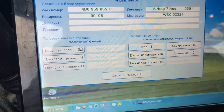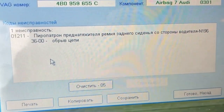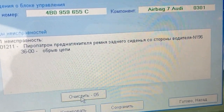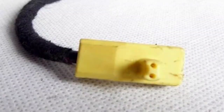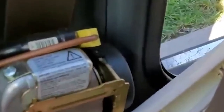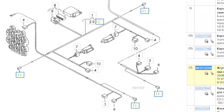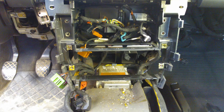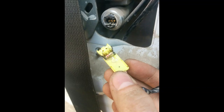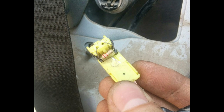When you connect a diagnostic scanner, you can see that the error is related to the driver's side rear seat belt pretensioner, fault code N196. After studying a little information on this issue, I came to the conclusion that in most cases it is the contact on the seat belt pretensioner connector. There should be no problem in the wiring itself, because from each pretensioner goes the wire without any connection directly to the airbag control unit, which is situated behind the climate control unit and the ashtray.